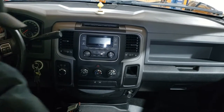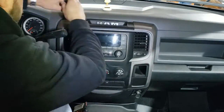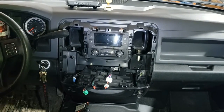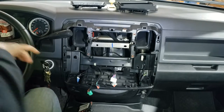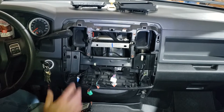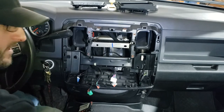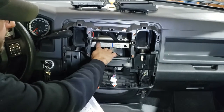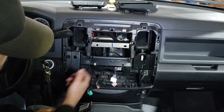Let's get this thing taken apart. I've got the dash removed — the console cover, whatever it's called — and the old radio removed. I've plugged everything and tucked it in behind. The instructions for the new faceplate tell me I have to remove this metal piece here, so I'm going to give it a little cut on the corners with the rotary tool and remove that.